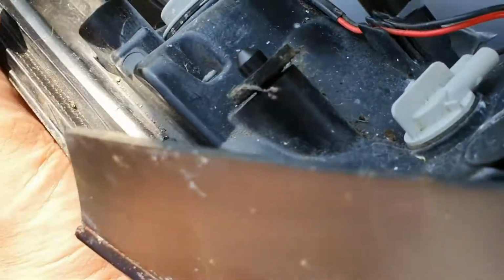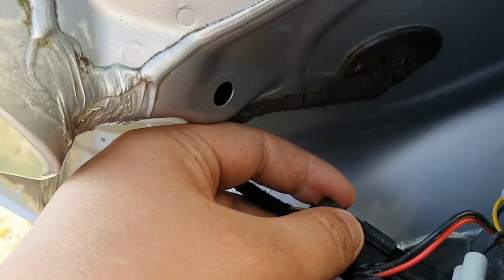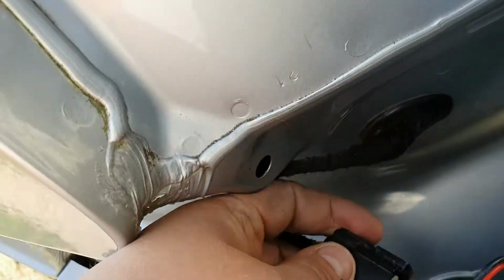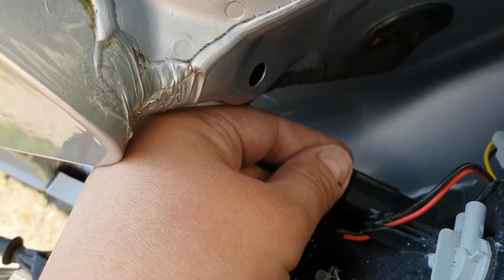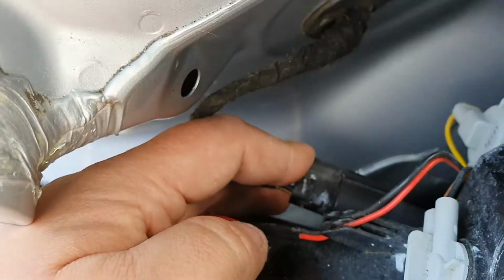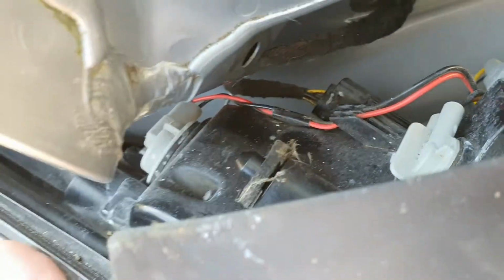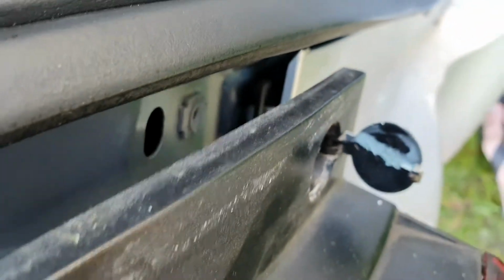You will notice that there are some locating pins. There's a rubberized one at the front there, so just make sure if that rubber is degraded at all, consider replacing it, because it does actually seal that area and stop water getting into the various body cavities. There's also some foam attachments on the other locating lugs, which you want to ensure are still present, as you can see one there covered in cobwebs, because they also help to seal everything and prevent vibration.